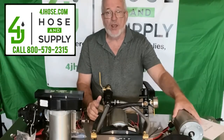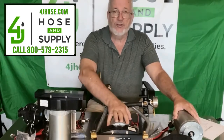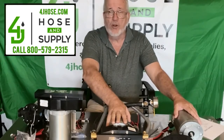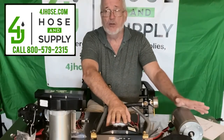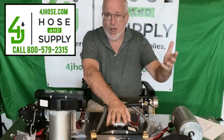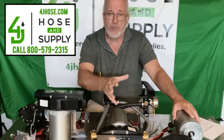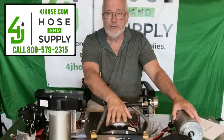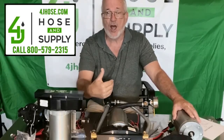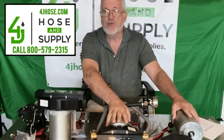Now if you want to upgrade, what you find here is a 5/8 horsepower motor. The standard that comes with the 80835 is a quarter horsepower. The quarter horse is going to pull about 25 amps, and even though it's always best to have an alternate power source, a large truck alternator may handle 25 amps. We recommend having a rechargeable power source hooked up to the vehicle that charges back up between your stops. This will have a 20 to 30 amp draw.